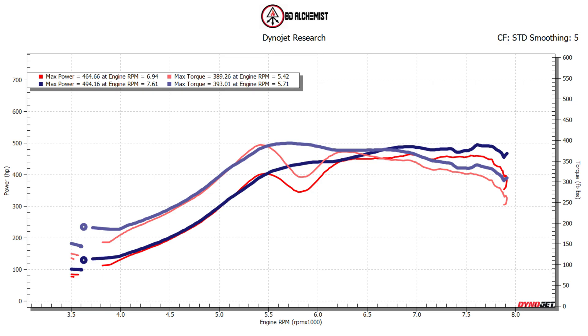This is on 26-27 pounds, moderate timing, and hello rich. Now I remember while tuning this — the wastegate. He had issues before where we found out the spring rate that Tial advertised is not accurate; it's off by a lot. So we literally had to test everything ourselves — seat pressure and static — by doing several tests, which is basically on the channel. If you go back last year when I tuned him, he posted some videos in my channel where he did all the tests to make people aware of the spring pressure advertised versus what you actually get. So now that everything makes sense, I recall that. We got the spring pressure versus the wastegate versus the efficiency of his manifold all squared out. I'm no longer worried about the boost curve. Now I'm doing additional fueling because it's hella rich.